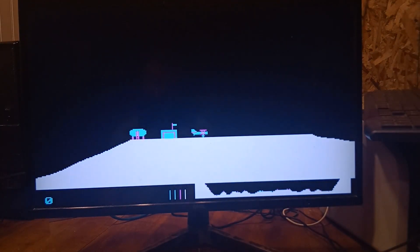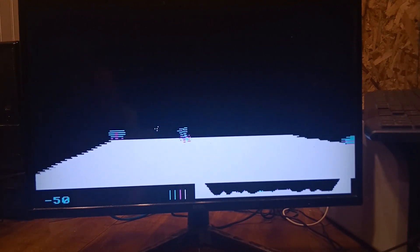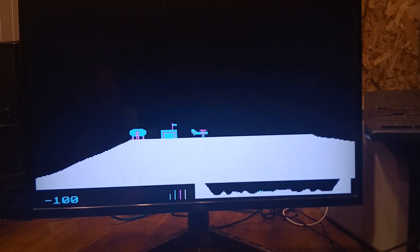You see that little flicker on the screen? That's just because when it's reading the video memory from the client PC it's not super fast — it's fast, but not that fast, and that's just kind of a blip. Also, on graphics mode on a CGA it's interlaced, so you're getting kind of the lines on there as well. But graphics mode is fine — it's usable.